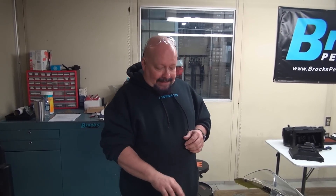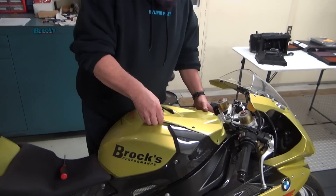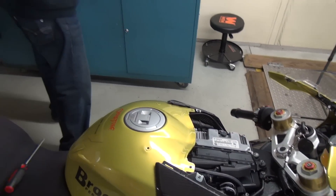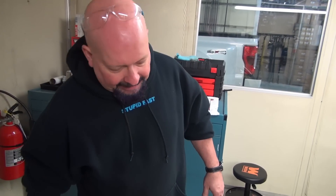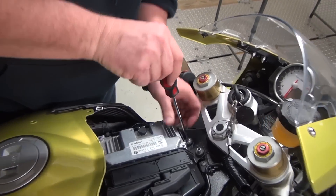So what we're going to do — I'm going to talk about how to properly install the air cleaner in this bike. It doesn't matter which air cleaner: stock air cleaner, aftermarket air cleaner, they all get installed the same way. But strangely, on this particular bike, it's pretty easy to jack up that installation and cause yourself grief. I've already pulled the bolts out of this gas tank cover here just to make things a little bit easier. All you really need is a number 25 Torx driver.